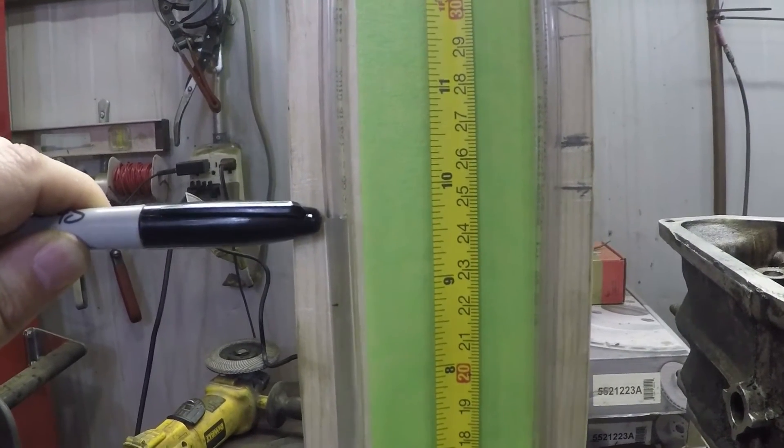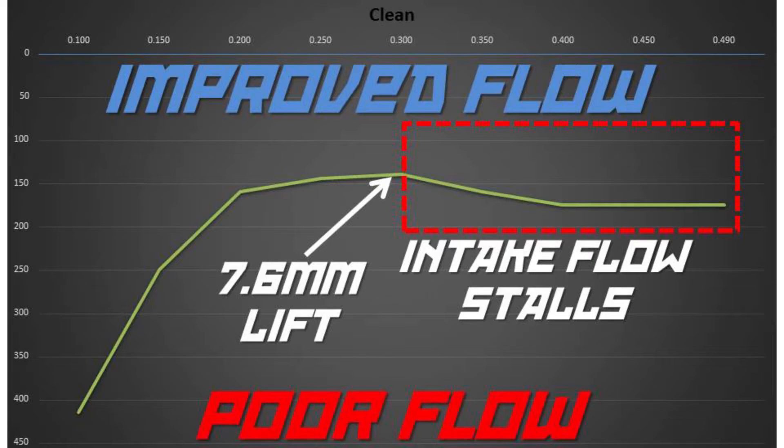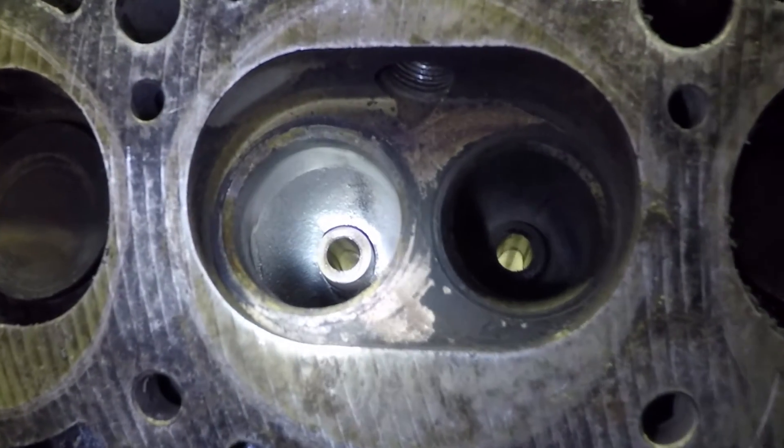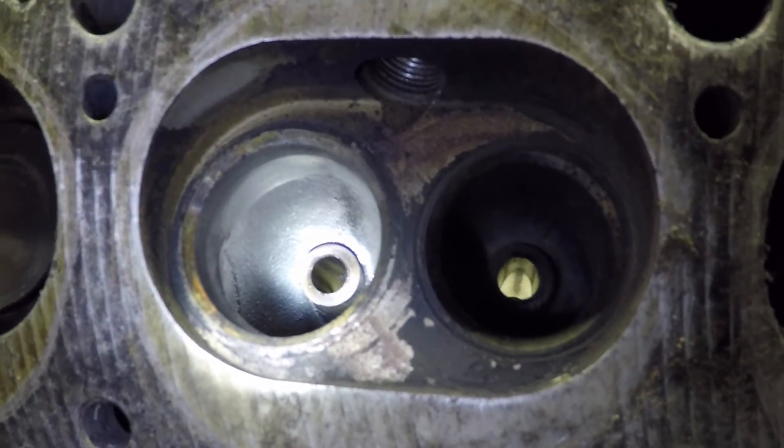The head actually flows quite poorly. It flows less at peak lift on any cam — whether it's stock or modified — than it does at 300 thou, which was quite mind-boggling. On the exhaust side, the exhaust valve didn't have near as much carbon as the intake side did, but the port was really, really dirty. We pulled about one millimeter of just carbon out of that port, and that really gave us a rewarding change. It made a big difference just removing the carbon out of the entire thing. Which also leads us to believe that if I removed a millimeter of aluminum, I should see the same type of change — as long as the valve is not the limiting factor in head flow right now.